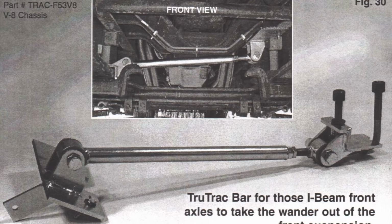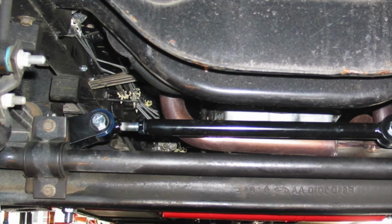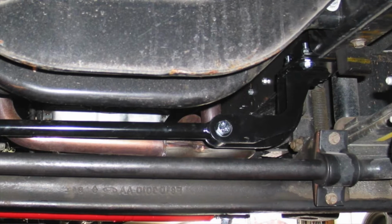That's right. We've learned that any coach or vehicle with a solid rear axle on leaf spring can benefit from a track bar. Eric Davis figured the same thing out on the front of the early Ford F53 chassis, which used a solid front axle with no track bar. Ford finally determined that was needed up front. They added an OEM front track bar in about 2006 to higher GVW F53 coaches. Yeah, it definitely shows the value of an upgrade when an OEM manufacturer actually starts doing it themselves.